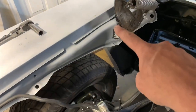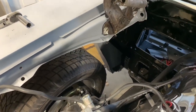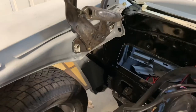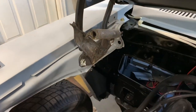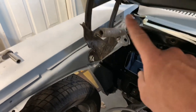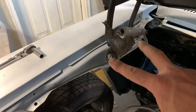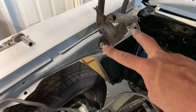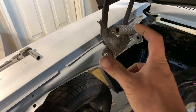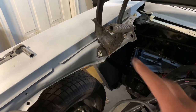There are two bolts — one here and one back there. I put some white paint marker on to highlight them but it didn't work, the stuff just ran everywhere. On this car the hinges still need restored but I want to demonstrate how to tweak this hood. These are the bolts we're going to take loose and wiggle the hood around. Right now our hood sits up too high in the back. Every time I do this it never works exactly like I think it should, but the best bet is to work a little bit at a time — you keep fiddling with these two bolts until you get it dialed in.